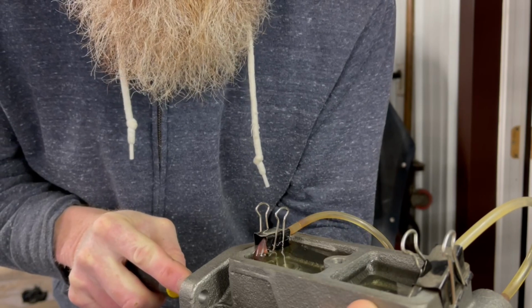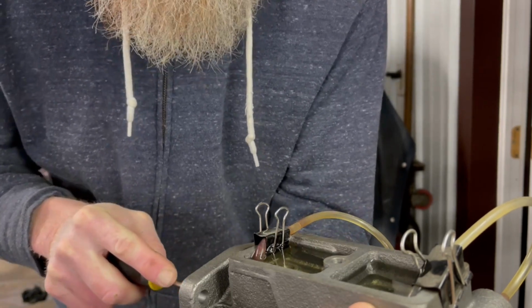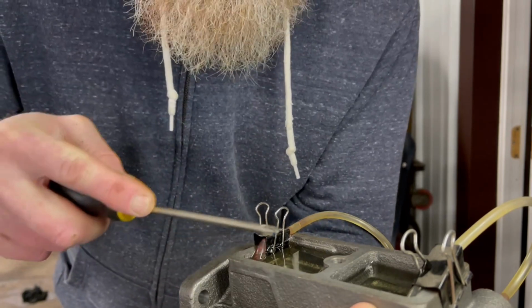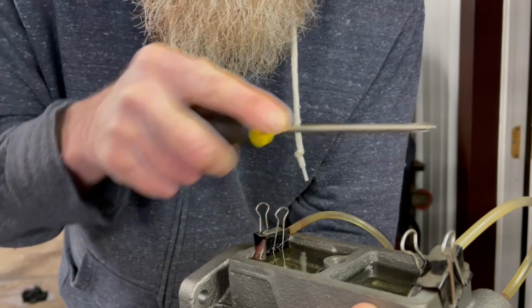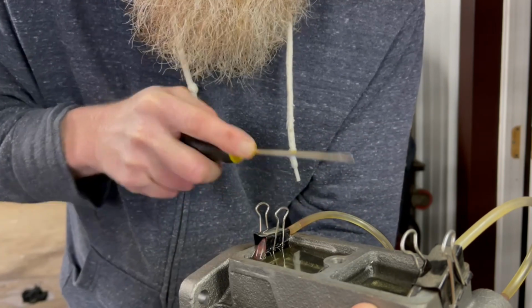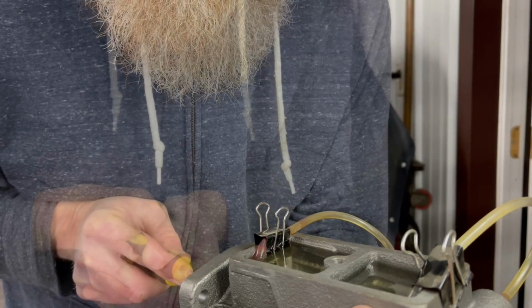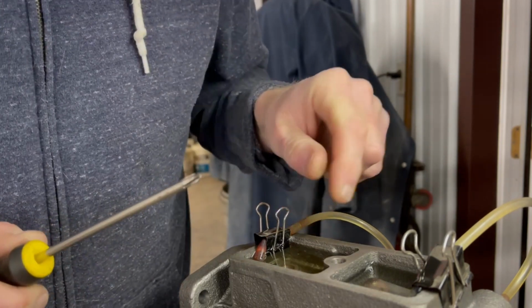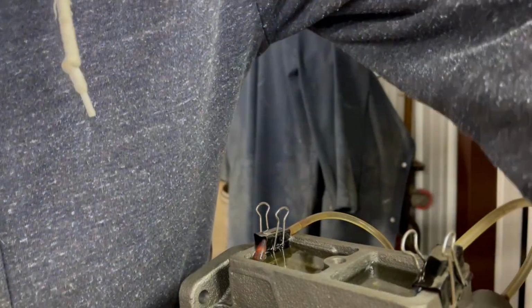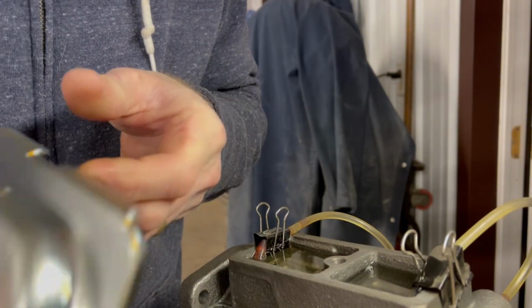I don't know if you saw that in that front chamber or not. When I let go, it sucks in the fluid, but if you pump and the fluid gives a little jump instead of air, then you know that side's done. This back one here is still giving a tiny bit of air, but we should be pretty close. And I think that's good. So now we can take these little plastic lines off with our paper clips, then we'll put the cover on it, and we'll be good to go until we need to bleed the wheel cylinders on the car itself.